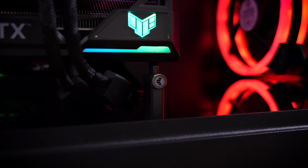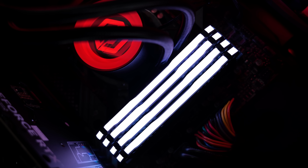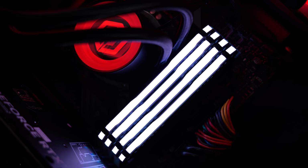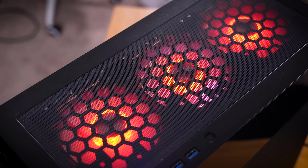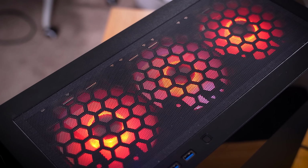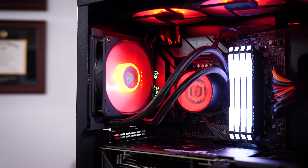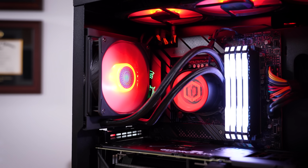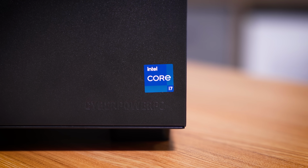And so, yeah, not every day we can replace a card like this with something of greater value, but again, we did have that one laying around and I want to make sure that he's up and running for years to come, hopefully. Doing something like blasting the 3070 Ti with hot air in hopes that the GPU or the memory gets reballed for X amount of time, it's not a permanent fix in my book, and I want to make sure that, again, he's got a system that actually works and isn't on the brink of breaking again.